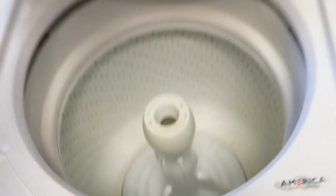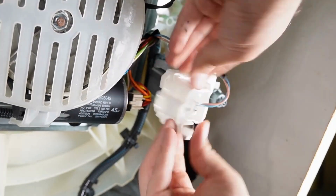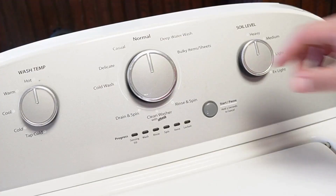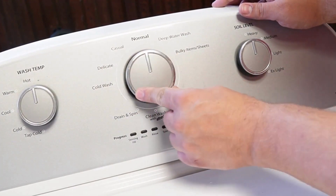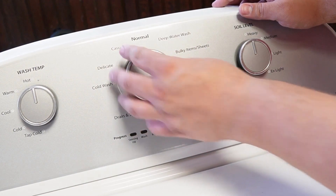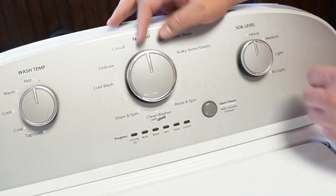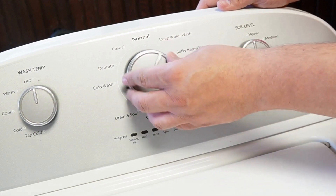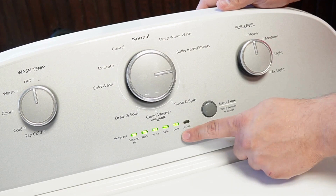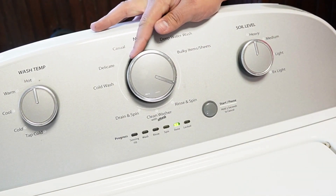Now let's attempt to recalibrate the washing machine through calibration mode — this is a must-do if you've installed any new parts, from a board to a balancing rod. With the washing machine freshly rebooted, rotate the dial counterclockwise 360 degrees, then turn the knob right three clicks, left once, then right once again. You need to do all these things within three seconds, and it may take a few attempts. If done correctly, all the lights at the bottom of the control will flash on and off, showing that you've entered diagnostic mode.